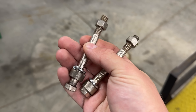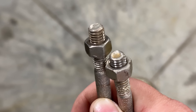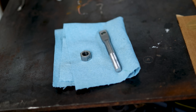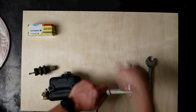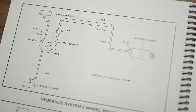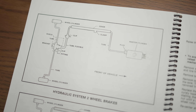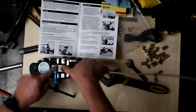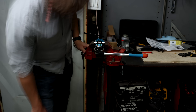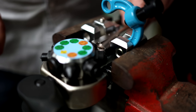The nickel plating worked, but it's a lot of steps. It seems clear that plain old nuts and bolts probably aren't worth doing. Unique hardware that's harder to replace is probably worth it though. Then I assembled the master cylinder. For the rest of the brake hardware, I decided to be scientific about it — instead of replacing it all right off the bat, I'd save some time and only replace what I needed along the way. So that meant instead of replacing the whole brake line, I just patched in a new piece, using what I learned from DIY Matt's brake line video and flared that new piece myself.